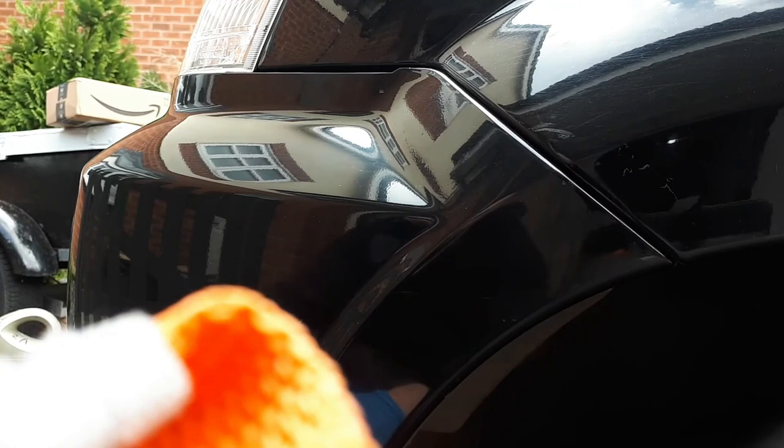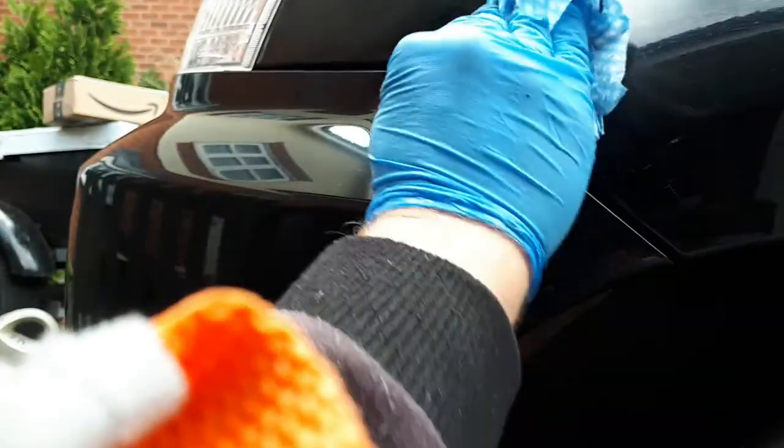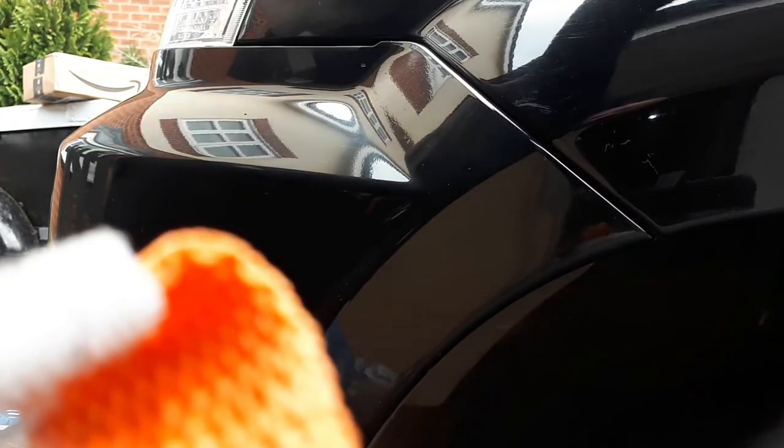There you go — a nice smooth effect if you do it on all scratches. Don't expect it to be absolutely perfect with scratch removers and colour restorers. They'll make it shiny but they won't give you the perfect effect. When you finish, apply a nice wax — even a hot wax — just to protect it and make it last. Colour restorers and scratch removers are good, but they only remove scratches and make it nice and clean. Then seal it with a good wax and you'll get a lovely effect.